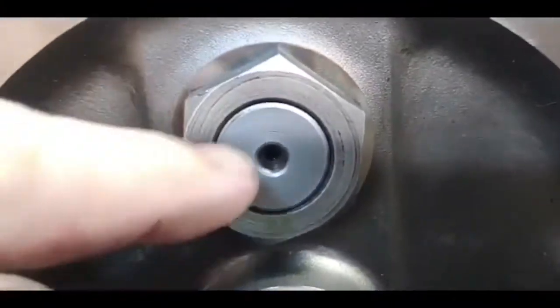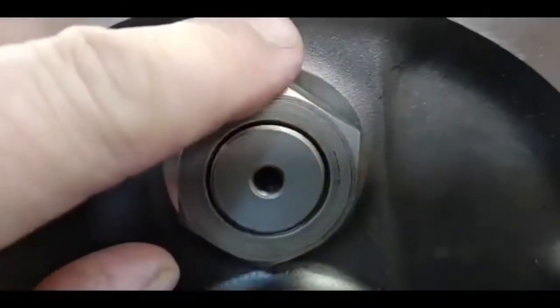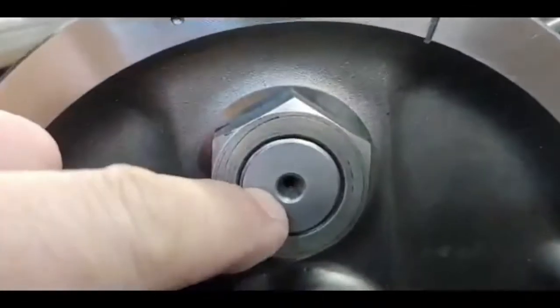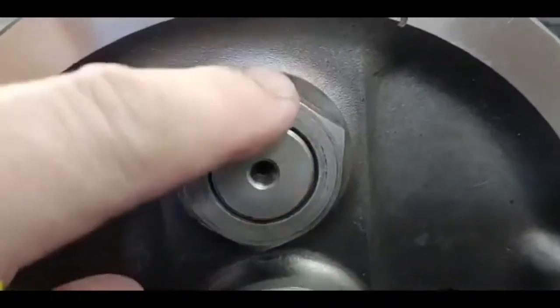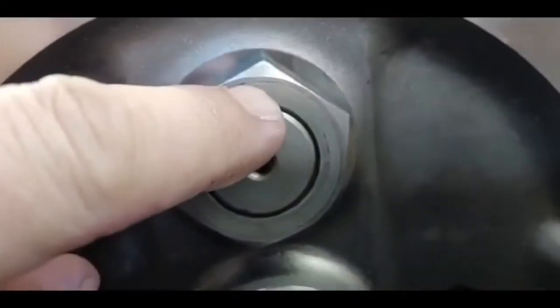When building a stroker motor, the crank pin is moved out further from center — hence being a stroker. So the stroke is longer; it's moved out farther on the diameter of the flywheel, farther from center out. The farther out it is, the longer the stroke. So on this four and three-quarter stroker shovel that I'm doing, this is moved out farther.